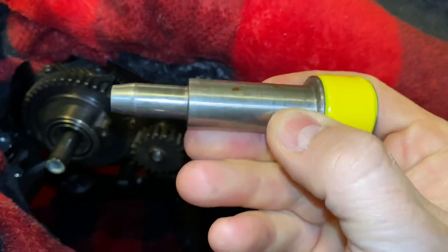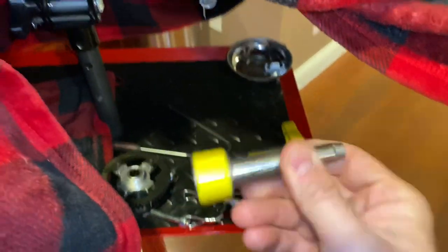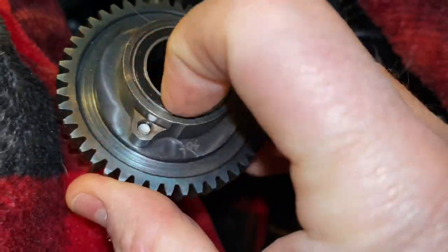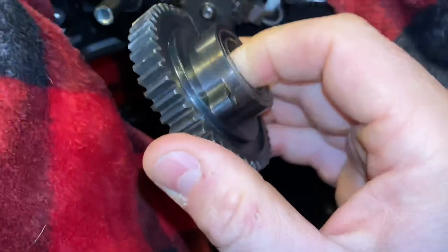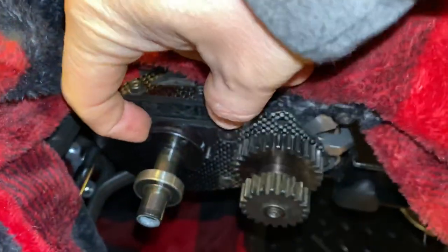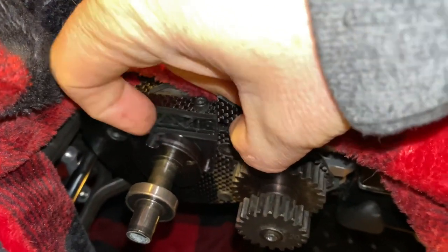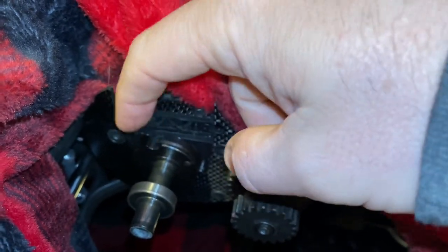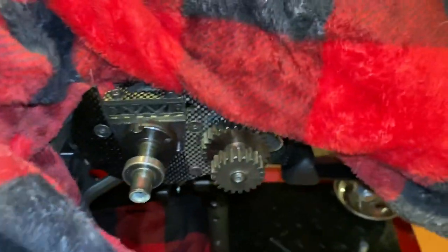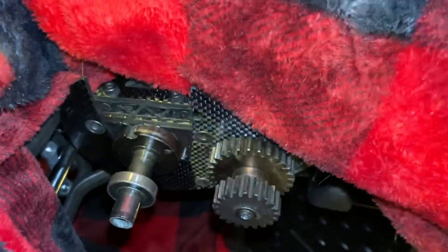You need a special tool - there's a special tool you can probably find at a small engine shop. I put yellow tape on it because I put yellow tape on everything, just in case you lose it in the field you can see it. When you go over your two-speed, just go over everything. These bearings - I have not replaced them, I'll keep them, they're still great. Here's another bearing. This is where your claw is. How I adjust that spring is by feel. Yes, you could do two turns and go from there, or four turns, but just be careful because some grub screws are different. When you put that FG spring in, who knows how many turns it's going to be - it won't be the same as the King Motor spring. Just go by feel.